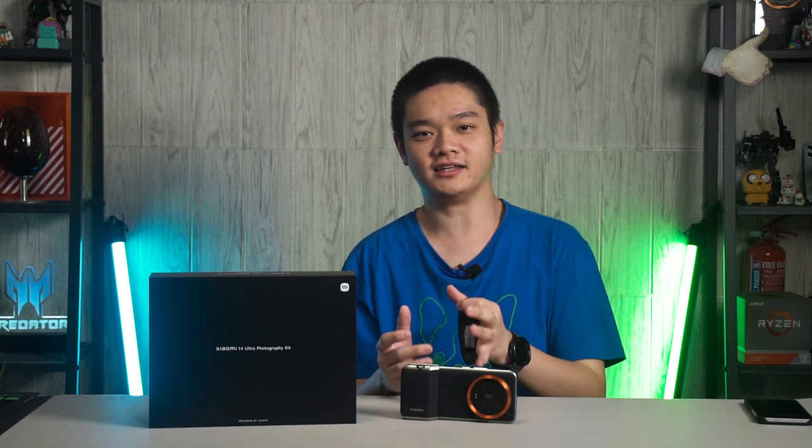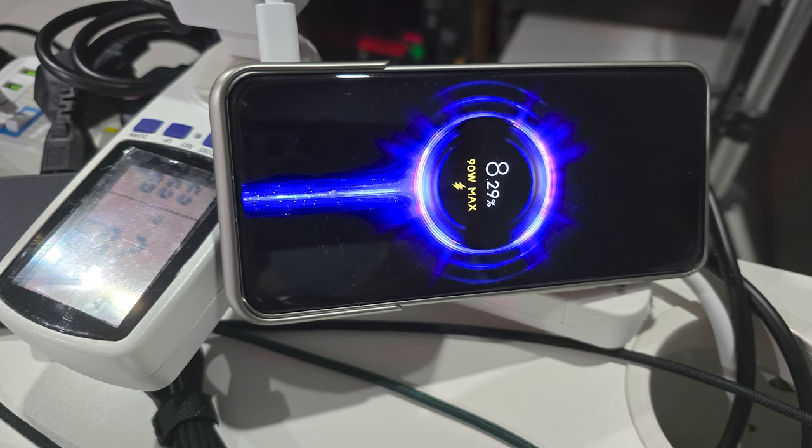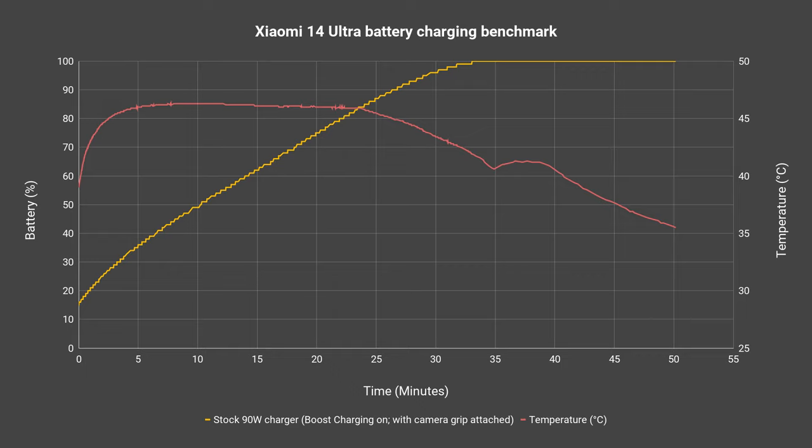The question is: if we plug in the 90W charger into the camera grip while it is attached to the phone, does it actually fast charge the phone? The answer is yes, but it's kind of buggy. I've seen the phone suddenly restart charging and quit the 90W fast charging mode when it's only at about 25% battery. I unplugged and replugged it and it didn't want to re-enter 90W fast charging mode — I had to restart the phone, let it cool down, and do whatever it takes to enter 90W mode once more. Eventually I did manage to get one full charging cycle with 90W mode enabled, and in comparison with just the phone alone, I don't think there's any difference.